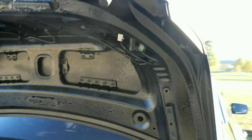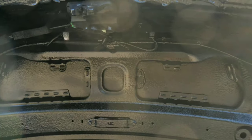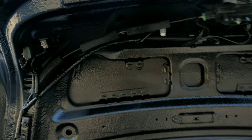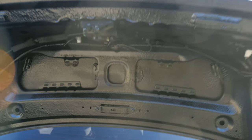We sprayed it down in the trunk — you can kind of see what it turns into; it just completely blackens out the trunk and gives it this really thick coating. It's supposedly supposed to help dampen vibration, which is exactly what I want it for. If this works really well, I may spray my doors with it. If it doesn't work very well, we'll probably go back to regular Dynamat. We'll close the trunk and play that same song and see how it sounds.